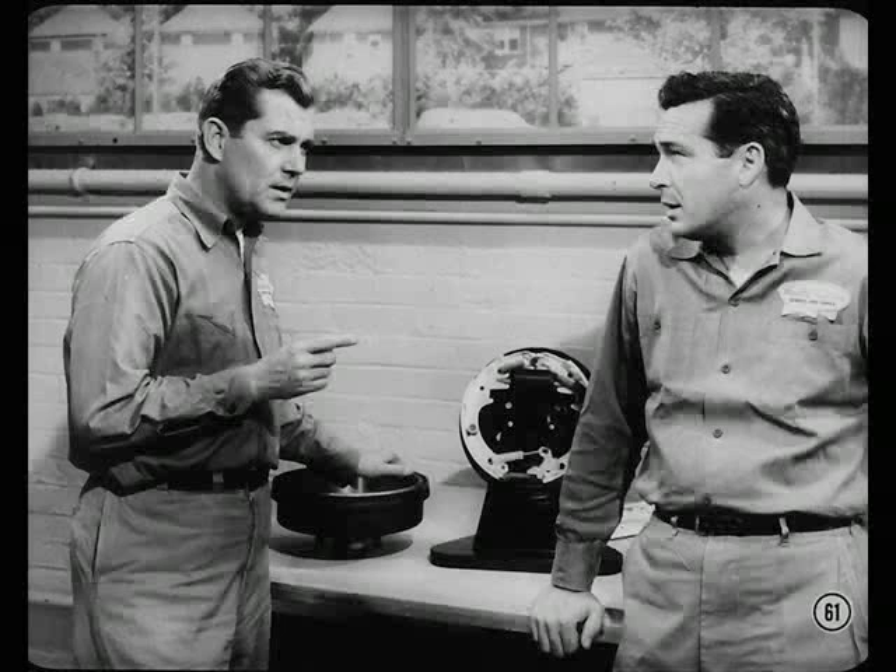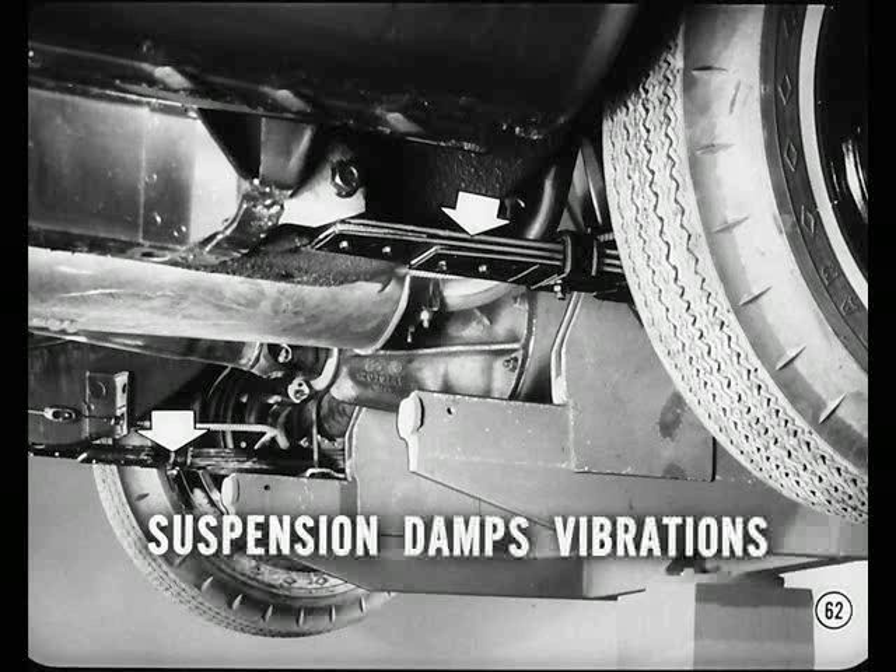But you said grind the front drums — what about the rear? The rear drums seldom cause brake chatter complaints, Smitty. Here's why: at the rear, the suspension damps out vibrations, so rear brake noise isn't a common problem. What's more, the front brakes handle 60 percent of the braking load.